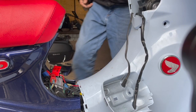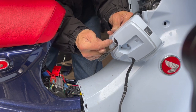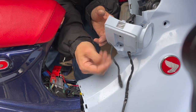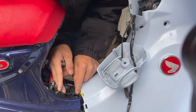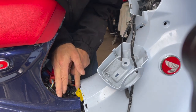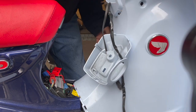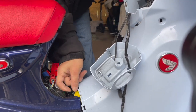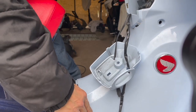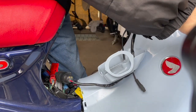I used a file on the bottom side of the hole — you can see it's a bit black there — just enough to get the plug through. I've taken all the slack out of the line so everything is on this side. I'd zip tie these wires but there's no space to get my hand underneath the leg shield to do it, so I'm leaving it as-is. I've tucked everything to the shifter side so hopefully nothing rubs.